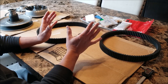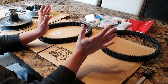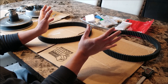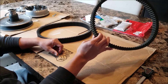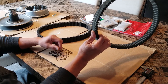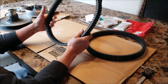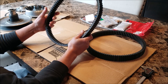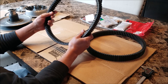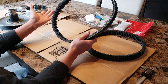A lot of guys — when somebody says they blew their belt, some uneducated guys will chime in with 'I've got a 10-year belt warranty.' Read the exclusions. It's pretty fair. It mostly covers belt failure, not belt wear. The warranty covers catastrophic failure from non-abuse. In the exclusions, if you're playing in Mud or Water mode, that's not covered. It explicitly states: if you get mud or water in the CVT, your 10-year belt warranty is void.